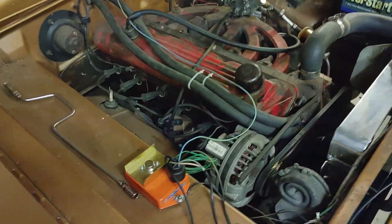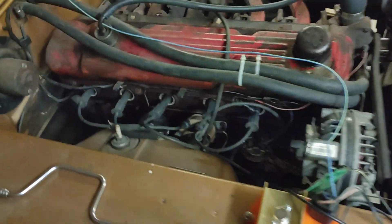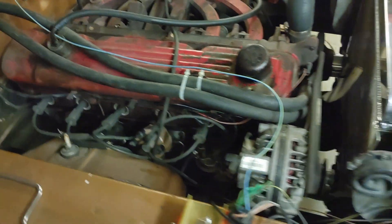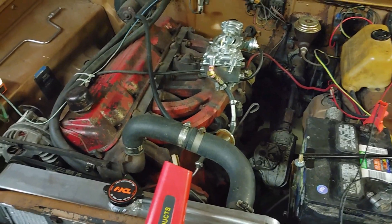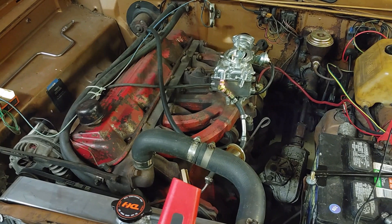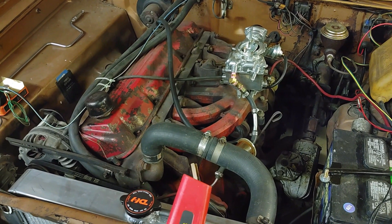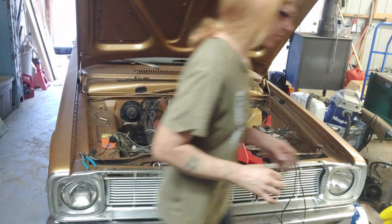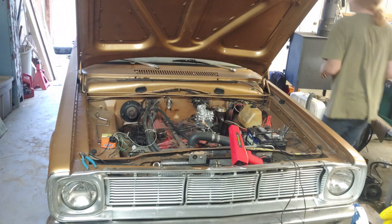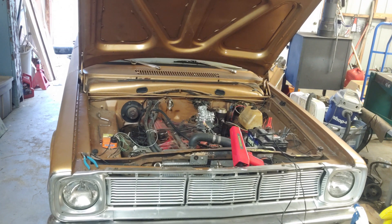So I did pull the distributor, put it back in, and adjust it so that I can add a few degrees of additional initial timing. We'll get it started and put it back in tune now that I have done my worst to get it out of tune. Okay, first start after doing a whole bunch of stuff to get it to go right again — part 1, 2, 3, 4.